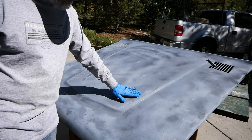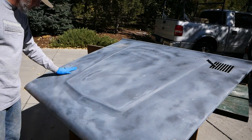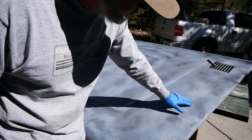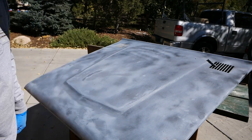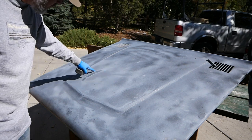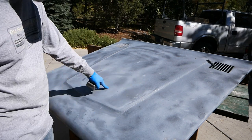After blocking, we found some high spots that have to be hammered down, and some low spots scattered across the panel. It looks like someone was underneath this thing just hammering — there are a bunch of little pinpoint high spots. I'm going to go one at a time and knock those high spots down. There's a super high spot there that I may fill around, since this whole surrounding area is low — that's why there's so much filler on this hood. This area here and here is all low compared to the rest of the hood.